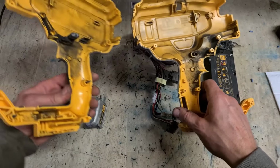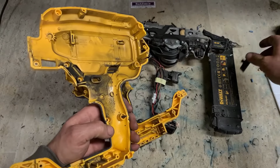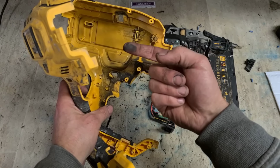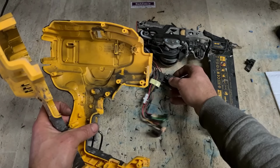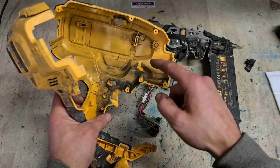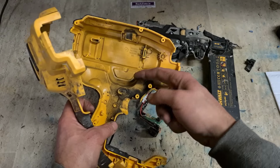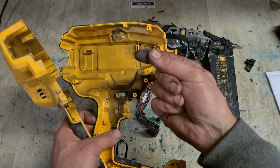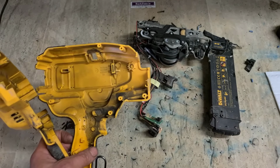Before we do anything else, I think I'll just give that a quick wee clean as well. Just clean out this housing. So that there's all just metal dust from the flywheel. That can be a little bit slippy if there's any cast or anything, or carbon buildup. That can give it a little bit of lubrication, to be honest, if there's any carbon in that, which you don't want on the actual flywheel. So we'll clean that off just in case.